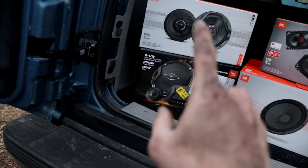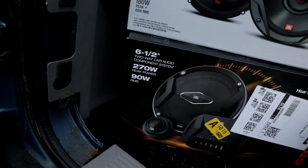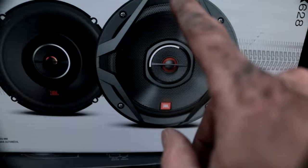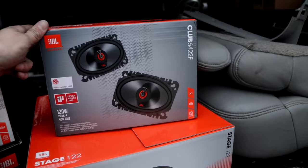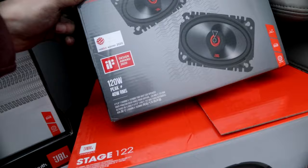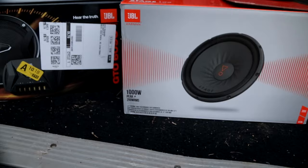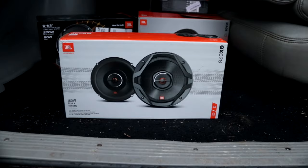Now for the part I've been waiting for — the speaker portion. We have all new speakers going into the truck and this will be a JBL audio system. For the front we have a component setup — the JBL 609C, 90 watt RMS. That should be pretty loud and have some decent mid-bass. Rear doors are going to have the GX628 coaxial speaker with a tweeter in the middle connected to a woofer. Back in the rear we have 4x6s to replace the 4x10s — JBL did not make any 4x10s so we got adapters. This is a Club 6422F, 40 watt RMS, plenty for those little speakers. For our sub we have a 12-inch Stage 122, 250 RMS — should be plenty of bass. I'll have prices and everything in the description.